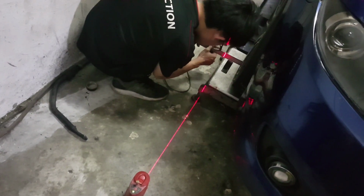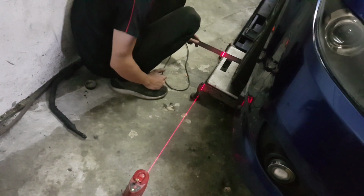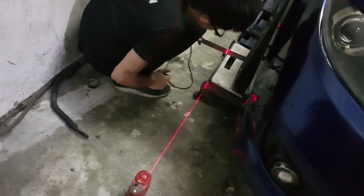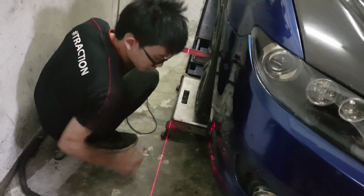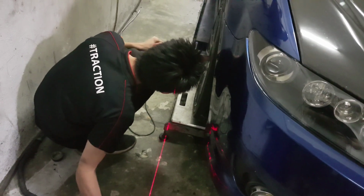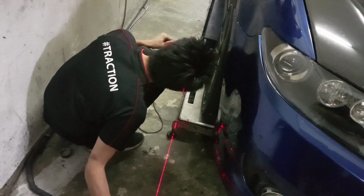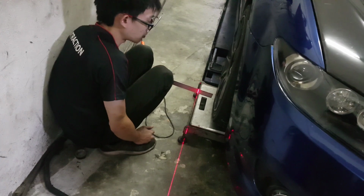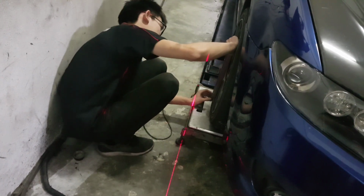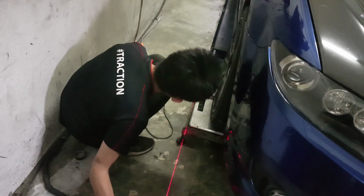How do you define that it's zeroed out? For us, basically we choose a starting point, the datum. So you really want to maintain equality between all wheels, you could just start from here, choose the number. So they start off from the center hub of the wheel for camber adjustment. If not, you can start at the bottom as well, either from the bottom or the top, but make sure it's a true center.